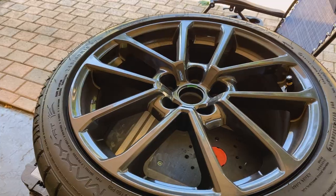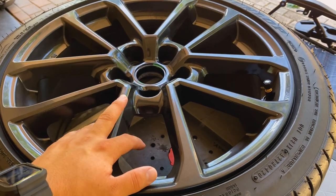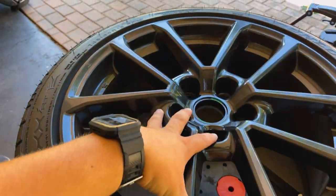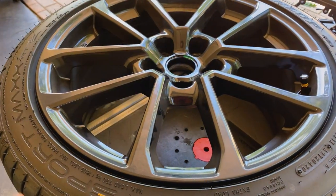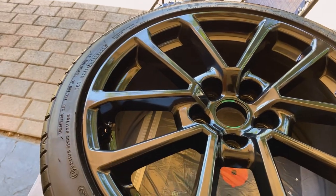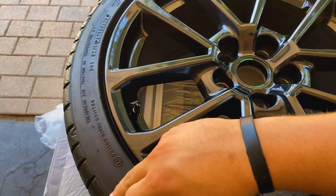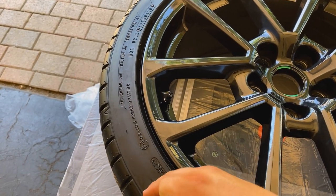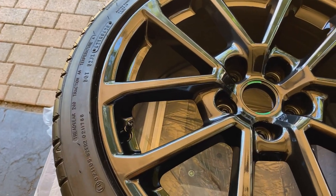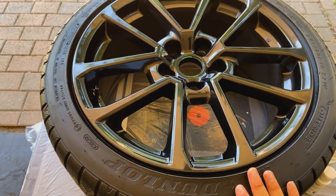Here are the wheels. He's got a premium trim, so he's got the nicer wheels. Basically all we have to do is clean them, let them dry so they're prepped and ready to go. Then you do your pre-dip spray — that's basically an alcohol that cleans the oils off your hands and any residue left on the wheel. You also do your dip release on the sidewall so you don't have to tape it off — it just prevents the dip from bonding there. You can do this on the car, but since we're also doing the brake calipers, we'll spray the wheels off the car.